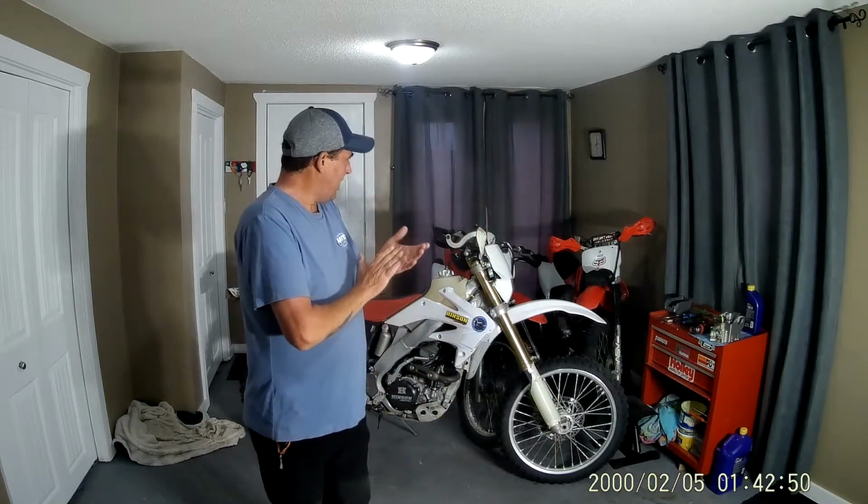So yeah, and no, my bikes aren't multiplying. We just got another little 230 here that was getting some work done on it. Friend of mine, his daughter, that's his daughter's bike, Madison. It was having some carb issues. It was leaking gas out of the air fuel mixture screw. So a simple little fix, just the O-ring was trashed in it.